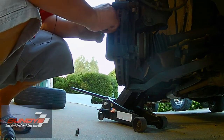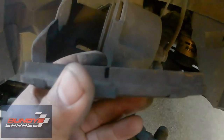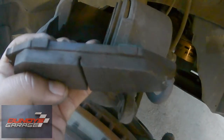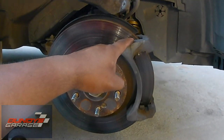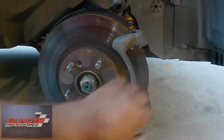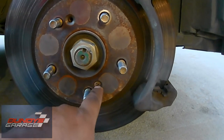Pop these pads off. The reason I'm changing these pads is they're pretty cheap pads and I want better stopping power — there's still a lot of meat left on them, I just don't like how they stop. Now, if you also want to change the rotor, you need to remove the brake caliper bracket, which is held on by two 17-millimeter bolts on the back side. Then there's this small Phillips screw right here that can be stuck in really tight — I'll put a link in the description below showing how to get it loose.